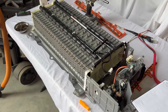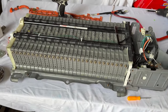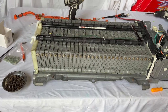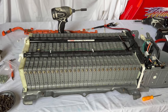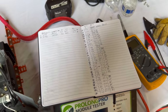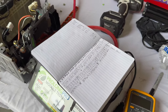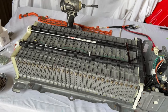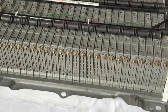I think what happened is something went wrong with the battery, probably lost a module, and someone tried to fix it in the car, found it too much of a hassle, and got rid of the car. On further inspection this is an original 2004 battery pack — it has age on it, but the numbers aren't awful. When I rebuilt the CT pack I had similar numbers and got it performing really well, so I have hope we can do the same here.